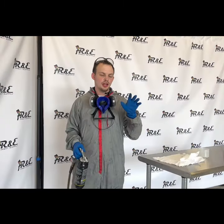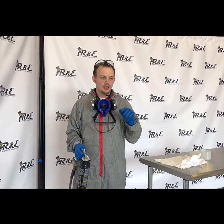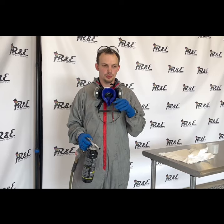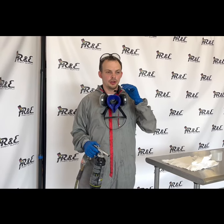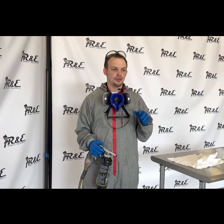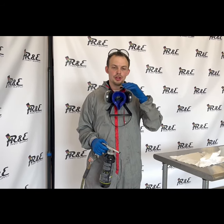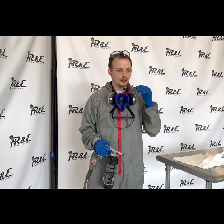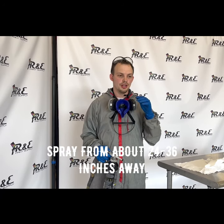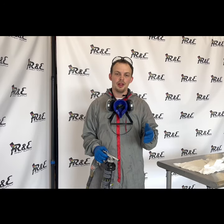We've already got two decent coats on this trailer. One of my favorite things to do, especially to add a little more slip resistance, is to crank the pressure up, stand back, and mist what I call a texture or control coat over this. It just adds some additional slip resistance and helps get a really uniform texture. You can apply two, three, or four coats of this product — just make sure you put it on as a medium wet coat.